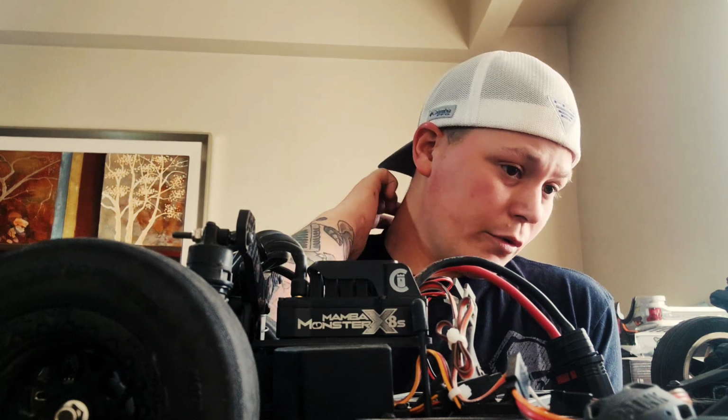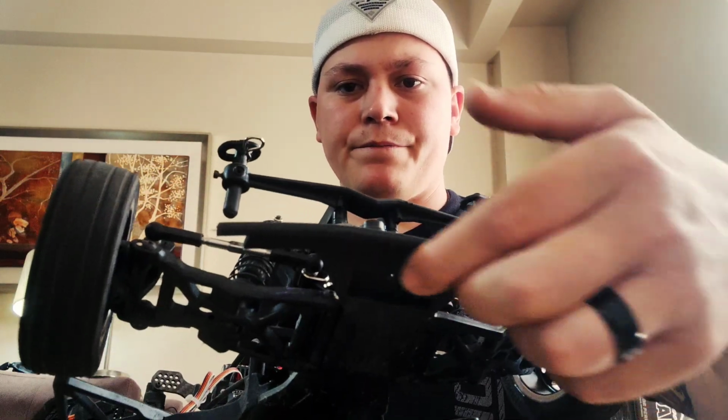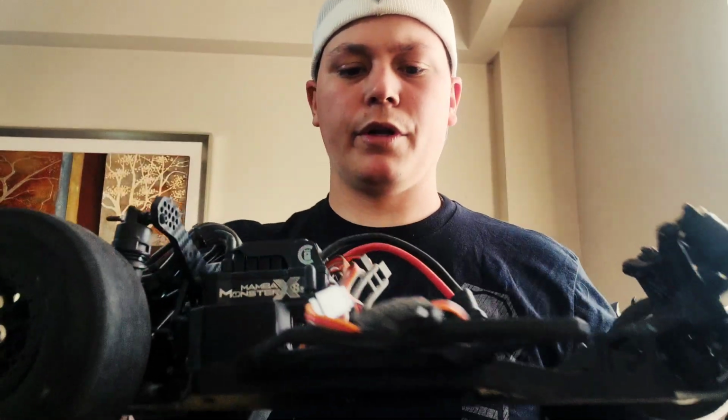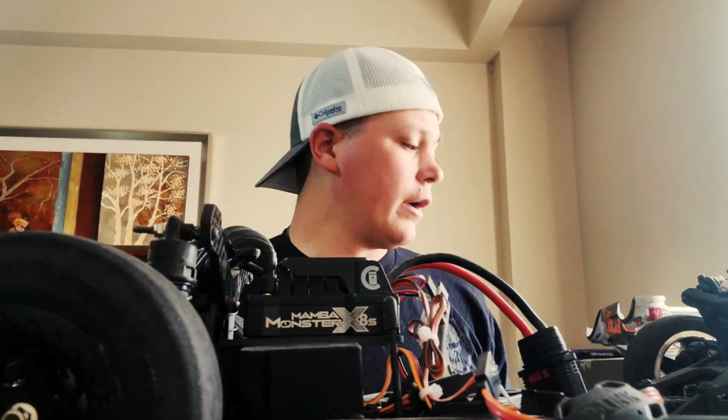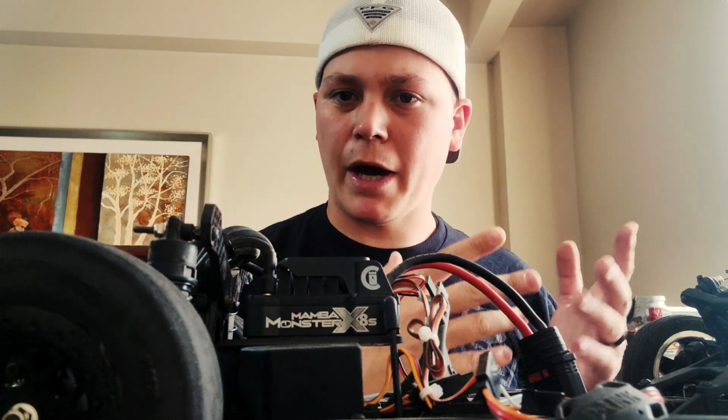Another thing that I would recommend y'all doing, which I'm going to end up trying to do, I'm going to drill a couple holes in the front bumper system here. And I have no weight in the front end of this car, and it runs straight. In future videos, I'll throw a clip or 2 of this thing running straight down the track. But with this, I'm going to drill a couple holes in the front bumper so I can put some body mounts and adjust them to where it holds the nose of my body out.